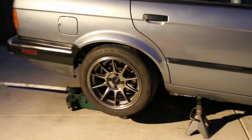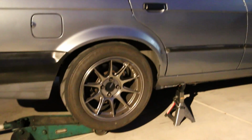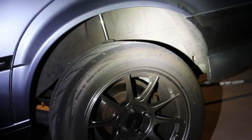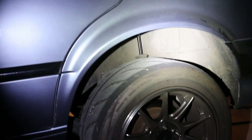Good stuff. So another thing you're gonna notice with the race coilover, or this competition coilover, is that it is fully under its own weight load, whereas a factory style setup with the coil and the shock has a lot more droop out. So you can see it has just a ton more droop out. That can change things a bit. That's really gonna tighten up the rear.